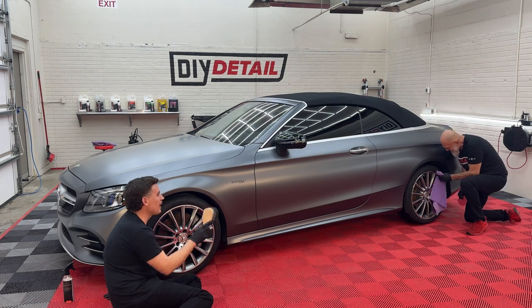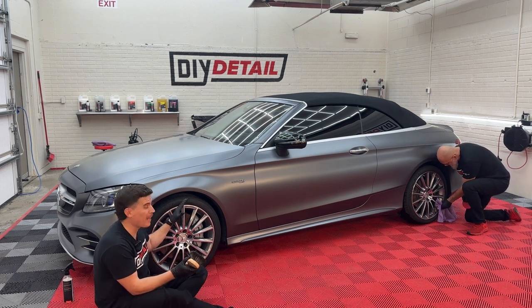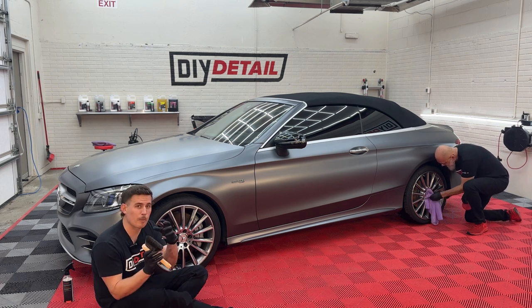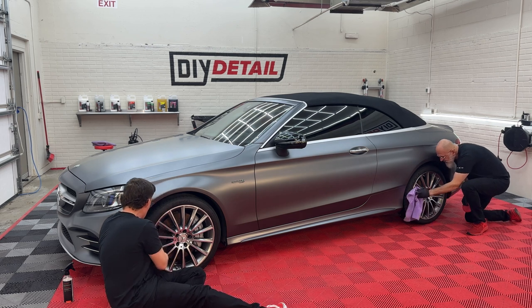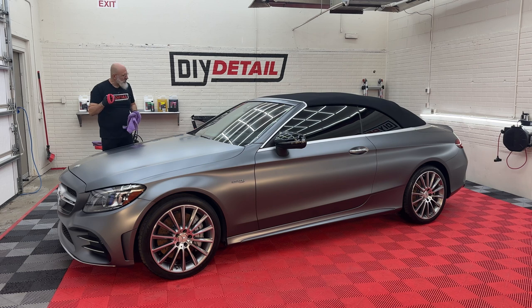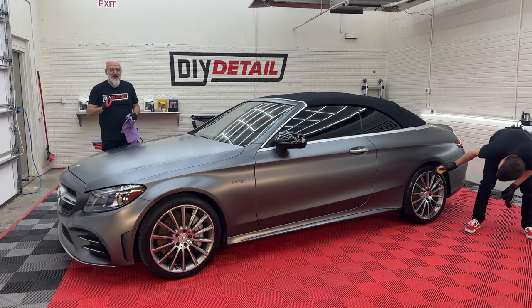I was applying the ceramic coating to the wheels. Now I'm going to do tire shine — a couple sprays on the brush, applying just to the tire so I'm not getting any on the wheel. We also get the question: do you need a specific wheel coating? You don't. Our coating is going on clear coat — what's on the car's paint is clear coat, and your wheels are clear coated too. It's the same material. Some people think the wheel gets so much hotter, but if your wheel is getting hot enough to damage the coating, your tire is long gone. The coating can withstand a lot more heat than your tire can.